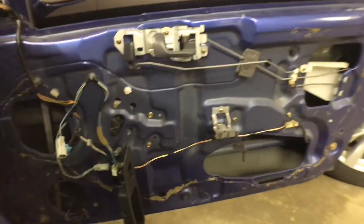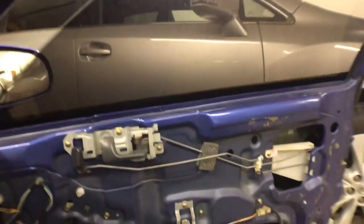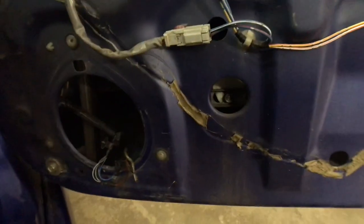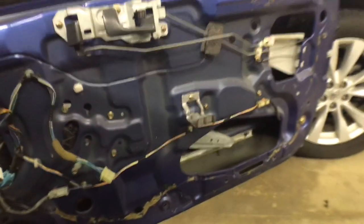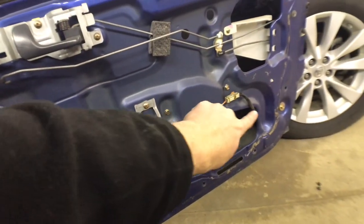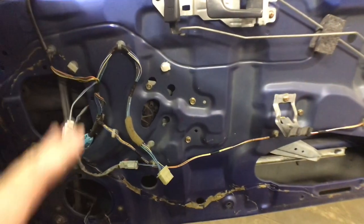This is what your door is going to look like with the panel off. Plug in your switch, then you have to drop the window down to where you can access the 10mm window bolts. That hole right there is to access the window bolt — this one is easily accessible. Remove the window at this point. Window is out. Now we've got to remove the regulator from the door, which is the hardest part. You've got these 10mm bolts here — one, two, three, four, five, six. That one may need to come out too. I don't remember on an EK, but this bolt may need to come out because the window run might have to come out. Some cars are a pain — like a Subaru, Subaru regulators are a pain.